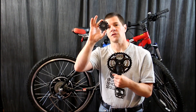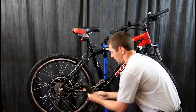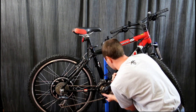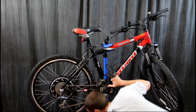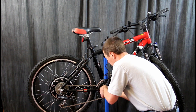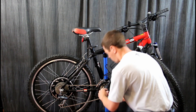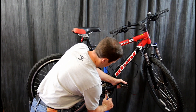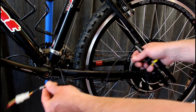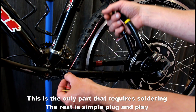Before we install the crank, we have to install this magnetic pickup. You'll notice there are arrows around the outside — that's the direction the pedals move — and it's pretty easy to install: just slap it on there, then go ahead and thread your chain back through and reinstall your crank. The wire that came with my pedal assist system is obviously way longer than it needs to be, and since I'm going to have to cut and solder anyway, I'm not going to use this connector but instead use a common servo connector.